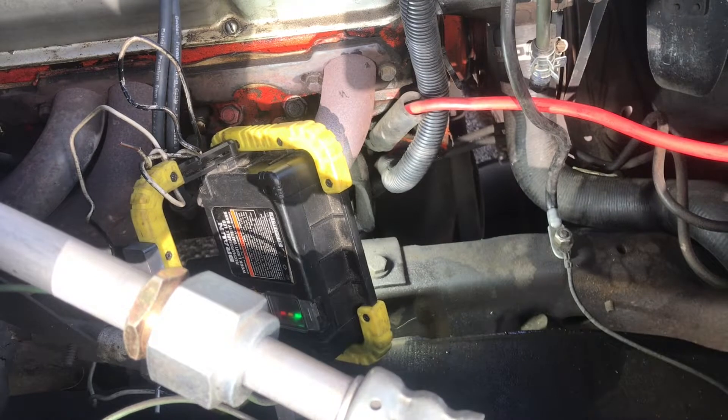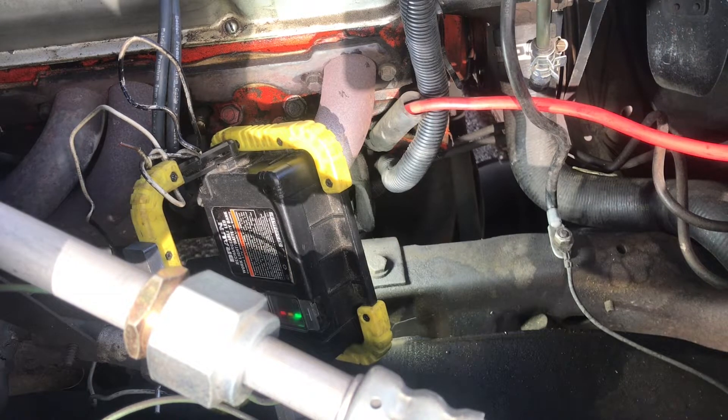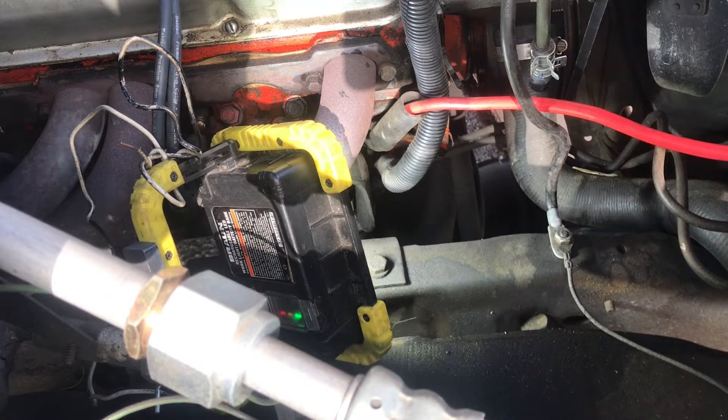The reason I'm doing that is this used to have a charcoal canister, so there's a vent pipe already here. You do get fumes from the tank, so I'm just going to tie into that and vent it back to the tank. I think it should work fine. Now I'm going to zoom in here and show you — get those hoses out of the way. That is a lock-off plate that holds your fuel pump and that rod in the dead center. That rod is what we need to get back up in there because it falls down. There is a bolt hole on the side — you can drive a bolt in and it holds it in place. Or what we always did is put some bearing grease on it — it holds it right up in place, and bearing grease is perfectly fine for the engine.